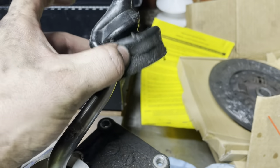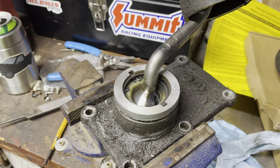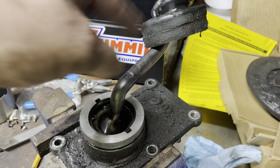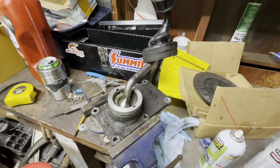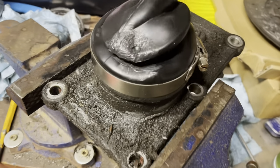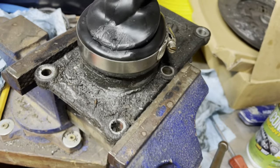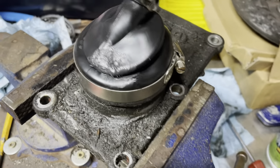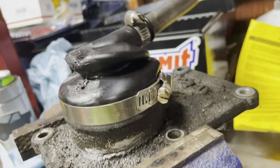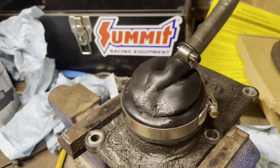My plan for this boot — it's split right here and there's a groove that it should sit into. Instead what I'm going to do is cut the bottom of this off, push that onto there, and get a hose clamp to clamp it on. I put a little RTV right there to seal up a small hole. The rest of the lower half I just cut off, clamped it right there — it's got full range of motion, put another clamp to stop it from sliding, and yeah that'll do just fine.